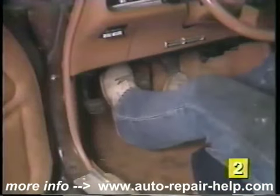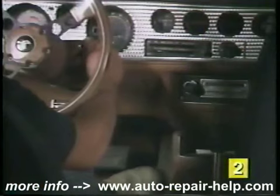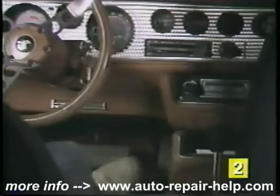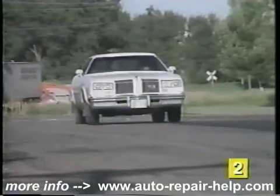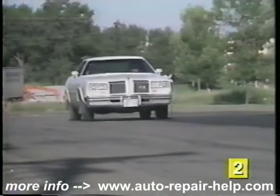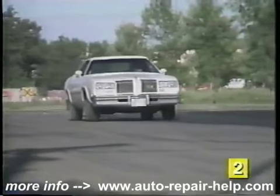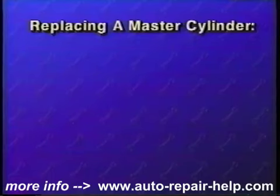Lastly, depress the brake pedal several times to ensure the pedal is at the proper height and is firm. If the vehicle is equipped with power brakes, you may have to start the engine to feel a firm pedal. Take the car out and test drive it, making a few easy stops at first. You're done. You've saved yourself money and at the same time gained the satisfaction of doing your own automotive repairs. Now let's review replacing a master cylinder.